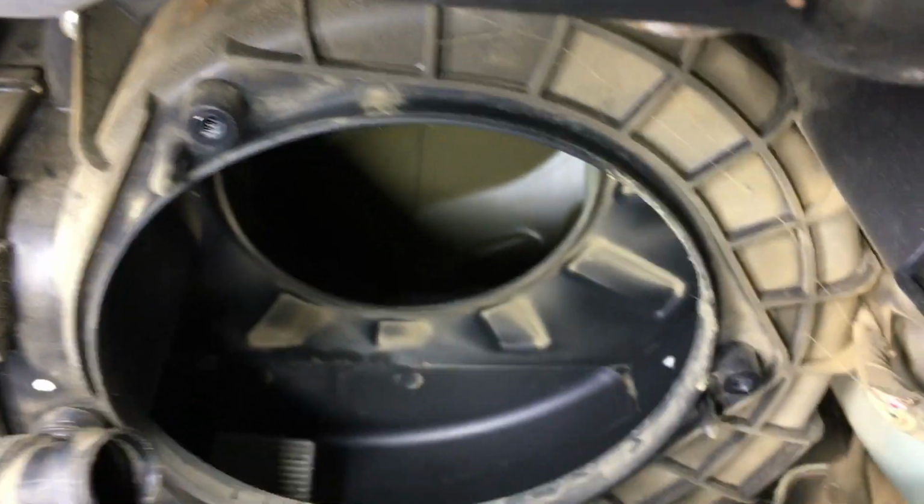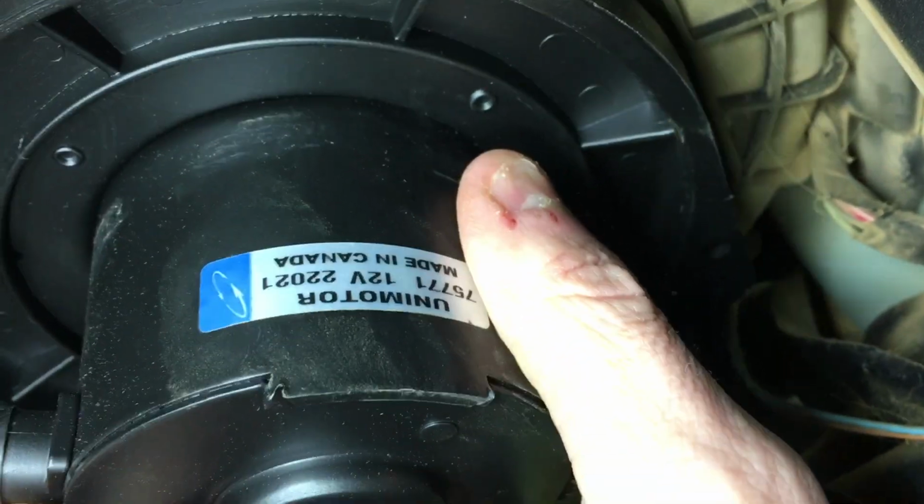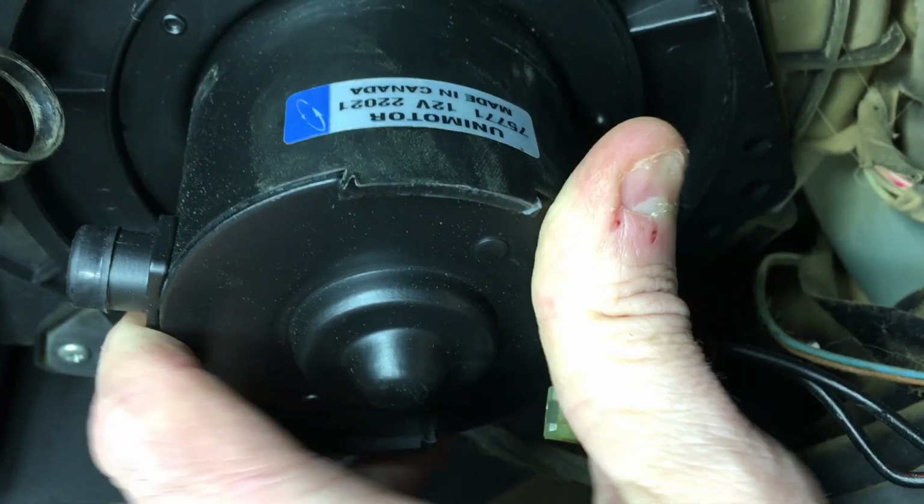So installation is reversal of removal. How many times have you heard that before? So we are just gonna take our fan motor, different plug connector now. Instead of being plugged to the motor, it's actually got a pigtail. So that's actually a nice thing. Cram, wiggle, cram. Bam, line up your, they're actually pins, I didn't see that, line up the bolt holes just right.